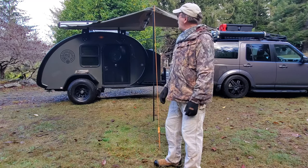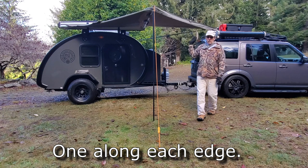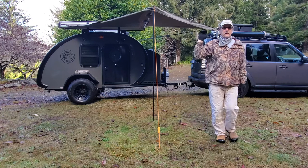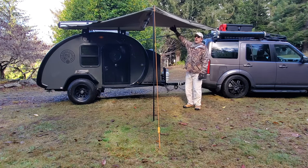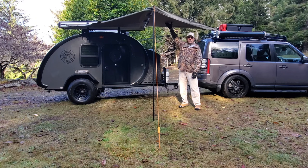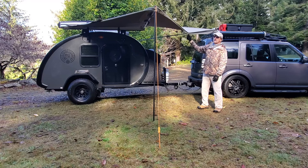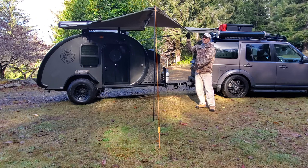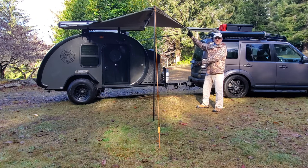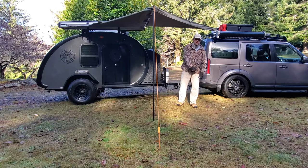There's an intermediate tie-down point right here. It's very important to use that if it's going to rain, because without pulling this down the water is just going to puddle and add more and more weight to the top of the awning. If you pull this down you can see there's a curve, and it causes the water to drain off the end — it keeps your camp area underneath drier and safer, and you won't have the catastrophe of water suddenly unloading and falling off the awning.